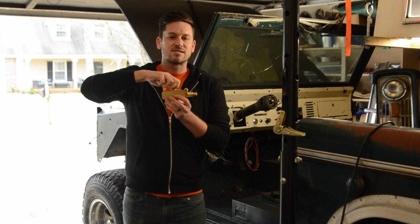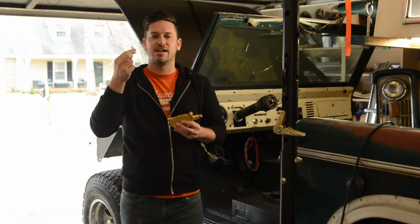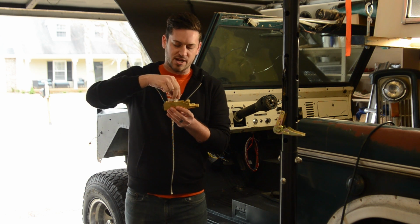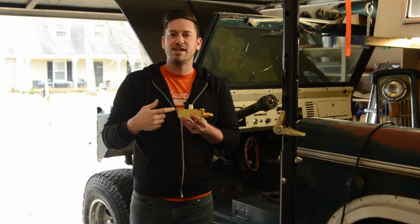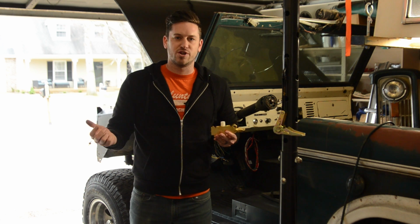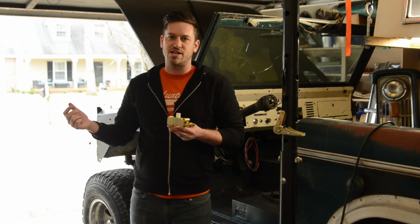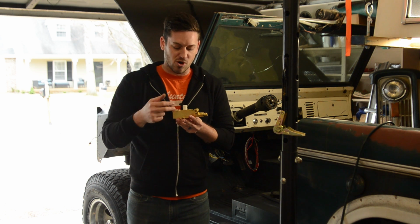But one thing to note, like I talked about, there is that pressure differential switch inside of here. So what you want to do is get one of these guys. It's like $6. They have them at Tom's as well. It goes in where your brake light warning switch was, and you just screw it in, and the little nub at the bottom keeps that piston from moving, because obviously that piston is trying to detect brake leakage. Well, when you're bleeding your brakes, it's basically like your brakes are leaking. So what that piston's going to do is try to close off whatever line you're bleeding and keep the pressure on the other lines. So this keeps that piston from moving and enables you to bleed your brakes more efficiently.